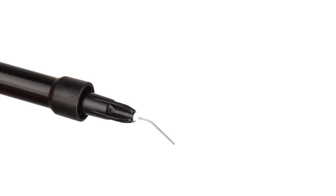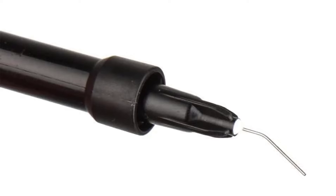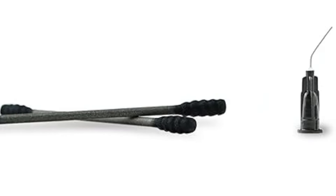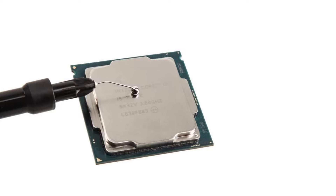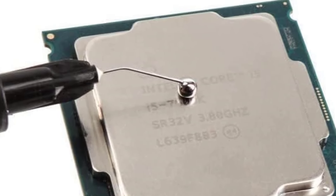This thermal solution is compatible not only with computer parts or laptops, but also with consoles — PS3, PS4, PS5, Xbox 360, Xbox One, Series S and X — and is great for dissipating heat from MacBooks. Conductanaut must not be used in conjunction with aluminum as it can permanently damage the surface, and can be used directly on copper or silicon.